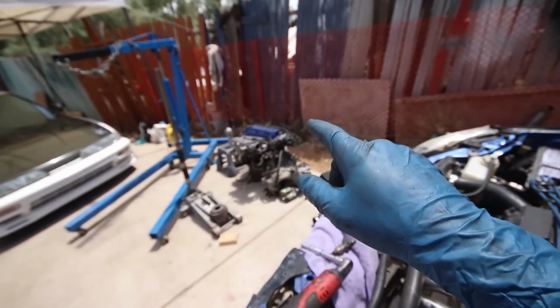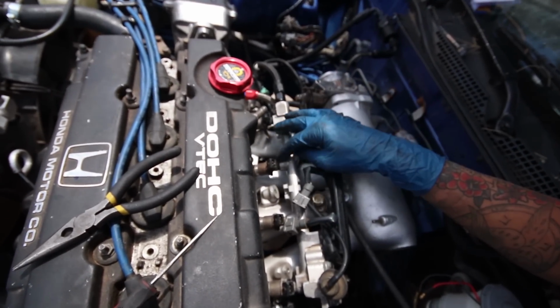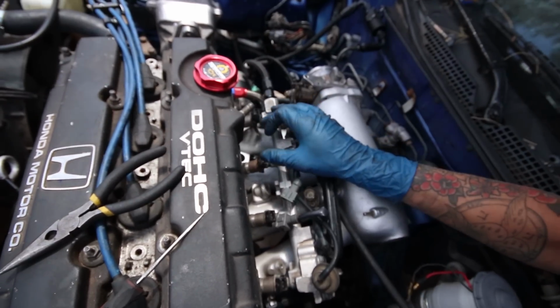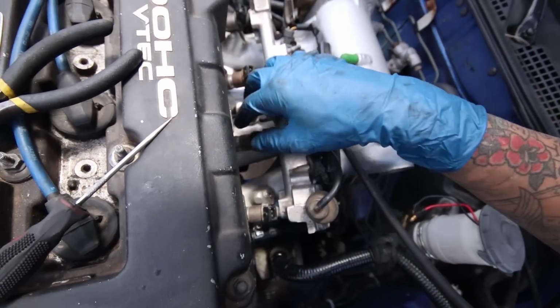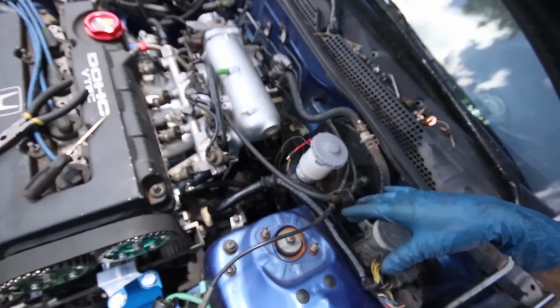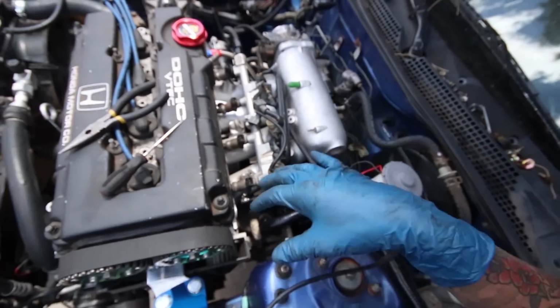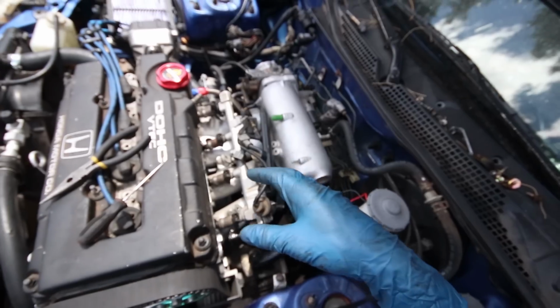So I'm just swapping the injectors off the D series. I called AD, he looked it up for me. They're all 240cc injectors, so they will be perfectly fine. So I'm just swapping those out. Got the other one right there, and I got some buildup on these ones. Someone wipe that off while I'm at it. Got this side of the harness plugged up, that side. Just finishing routing it. And then engine harness will be good. And yeah, one piece at a time, I suppose.